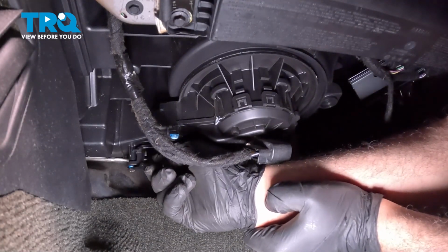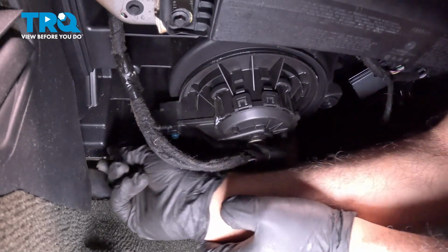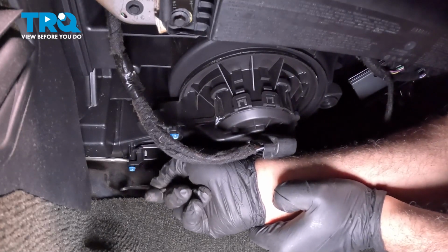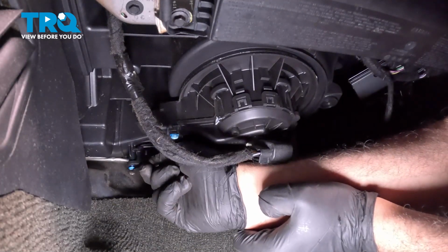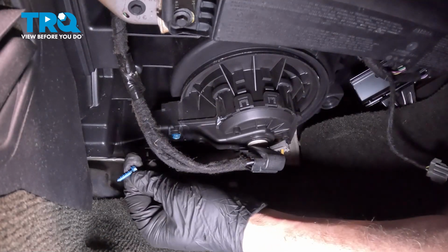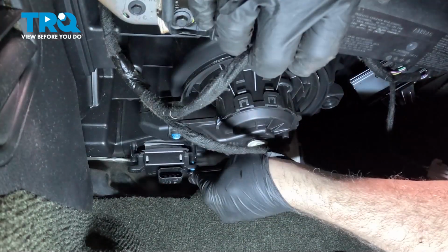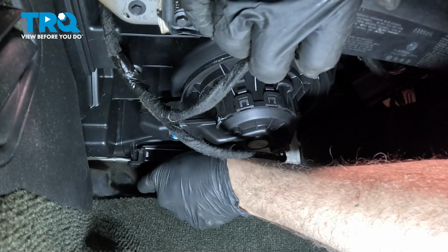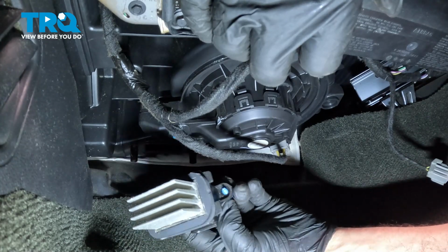So we switched over to an 8mm wrench itself, a little stubby wrench. Due to the clearance between this little plastic trim with the insulator here, you don't have a lot of room to work. Once you get that loose enough, you can go ahead and spin that out. Let's go ahead and get the other one. Go ahead and lower the resistor out.